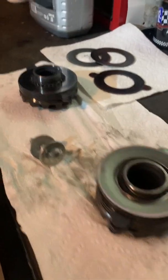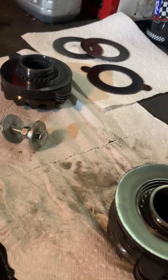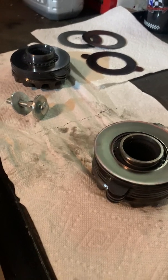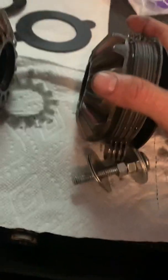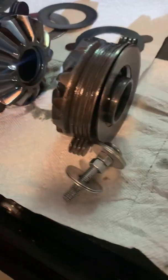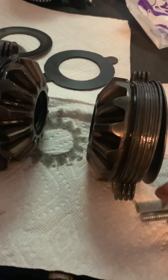I'm going to show you this little tool that everybody has — there's several videos on it. Several different guys have showed you how to make this tool. Ford makes a tool, but you've got to pull the carrier out to do it with the Ford tool. So here's what we've got. These are side carrier gears. They sit in that rear diff like this, and you have spider gears that sit at 12 and at 6, and it spins around. When I get ready to install this, I'll make another video putting it back together. But what I'm going to show you is this tool — pull that center pin out of the rear diff and you insert this tool that you make. It sits in there kind of like so.